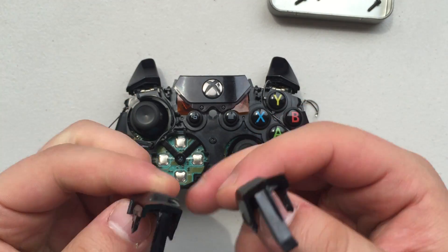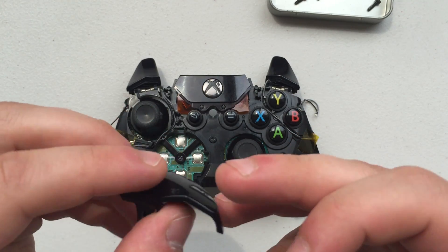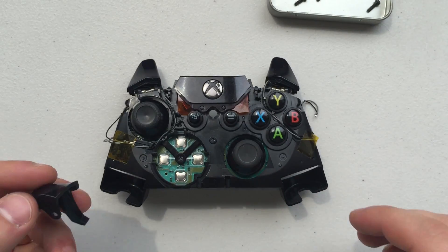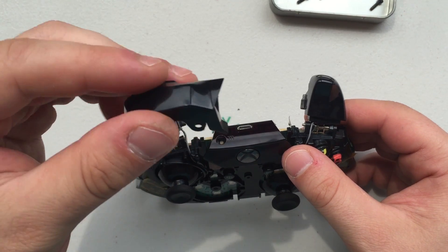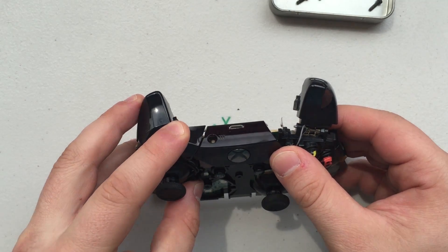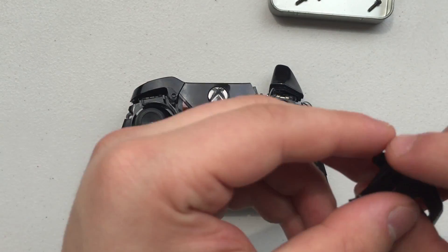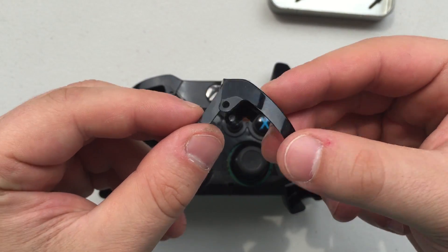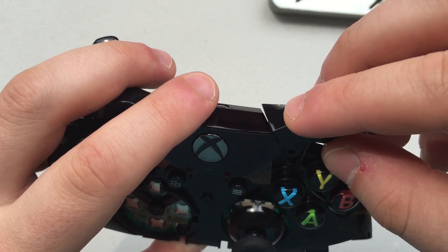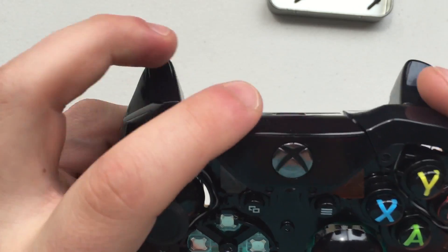The next thing you're going to do is put the left and right bumper back on. If you haven't checked out my video on how to fix these bumpers if they break — which they commonly do — check it out on my channel. Once you have the housing back on for the Xbox home button, it's going to be really easy. You're just going to slide the bumper in between the controller structure and the Xbox home casing, and it's going to slide and snap right in. There are two little connectors that will slide over these plastic things that stick out, and you're going to hear them click into place. Once they do, you know that the bumper is working properly.